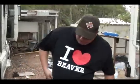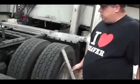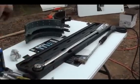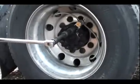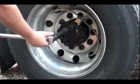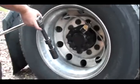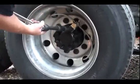Anyways, we'll take the crossfire off, and then we'll take the lugs off. Like I say, I use a breaker bar and a long pipe because I don't use air tools. Then I use my trusty torque wrench, which is getting rained on. I'll wipe it off to put it back together so I know I'm properly torqued. These bolts are supposed to be torqued, depending on what hub you got, 180 to like 220. I always torque them to 215 on my truck. These little inner axle bolts.